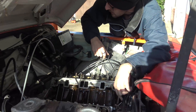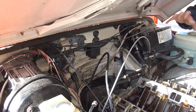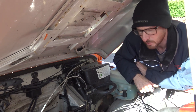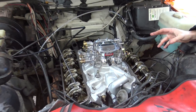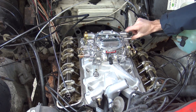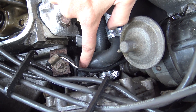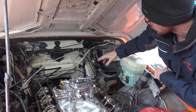The airbox is off, which obviously opens up a lot more space. This car's got lots of extra wiring in for its various jobs it's done over the years, which the customer is going to remove gradually when he gets the car back. Our task here is carburettor and ignition. You can see here the S-pipe bend that goes from the thermostat bypass onto that second inlet to the water pump on the back of the timing cover. That's why that gets drilled out - for the correct thermostatic bypass so that you don't get any weird temperature spikes when the engine's warming up if the heater matrix is blocked off.